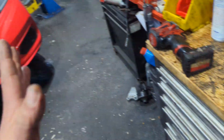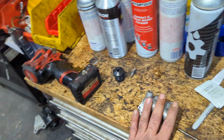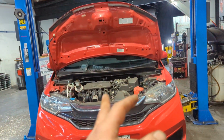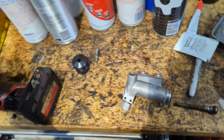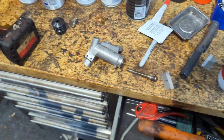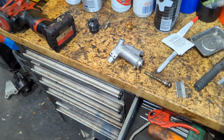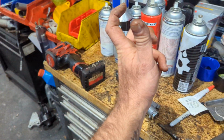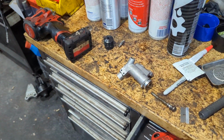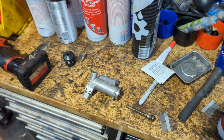It can be very quick, or it can ruin your entire existence if you think that you fitted a slave and that the master clutch has collapsed on the firewall, right? That's what people always think. Hydraulics are a huge point of contention. I've seen the best mechanics get confused and argue and start stating their opinions, and they're always wrong. If the master clutch was working, even if you've got 200,000 Ks and you've not pumped the pedal to the end and ruined it to a place where it shouldn't have gone, it's not going to be a master clutch, but you're going to think it is. And I bet how many of you out there have done this job and changed the master clutch.